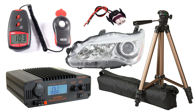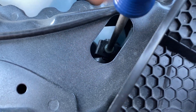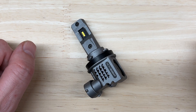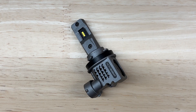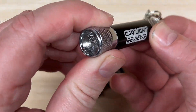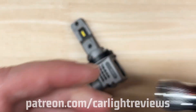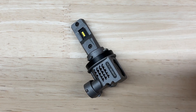My tests aren't for lux number accuracy but for comparison to a stock H11 halogen bulb, which measures 725 projected lux and 910 reflected lux using my test method. Different tests in different environments will give different results, so I list all the equipment I use in the description if you want to replicate it. Check the description for important notes on aiming headlights, ensuring you've picked the right headlight for your application, and the legality of replacing halogen headlights with LEDs. Also, you can get a Car Light Reviews LED flashlight keychain by visiting my Patreon page to support the channel.